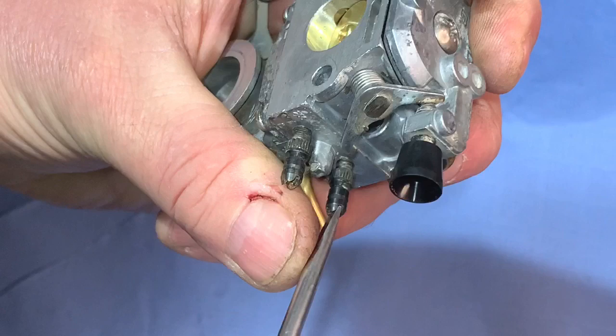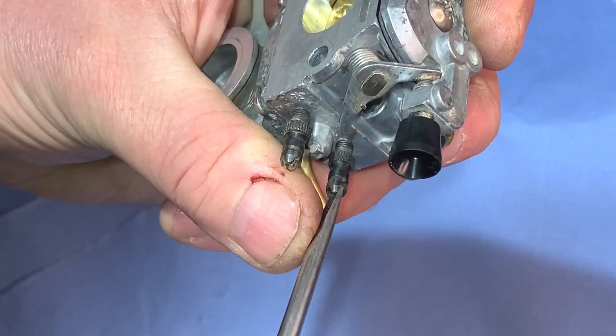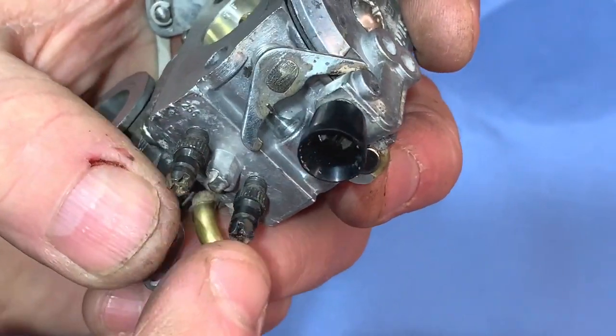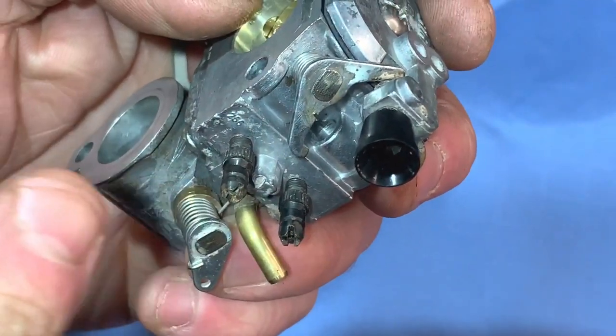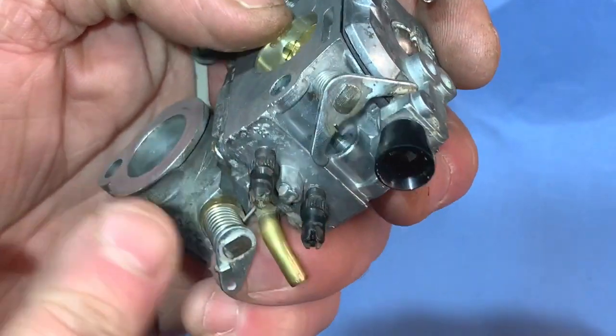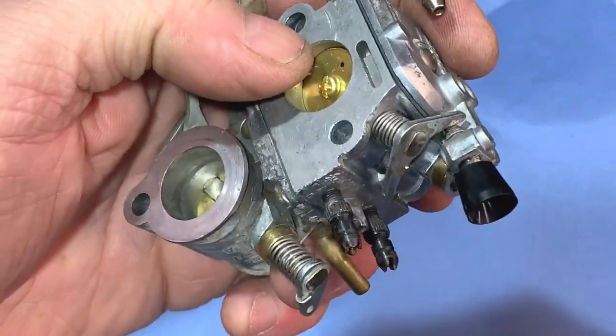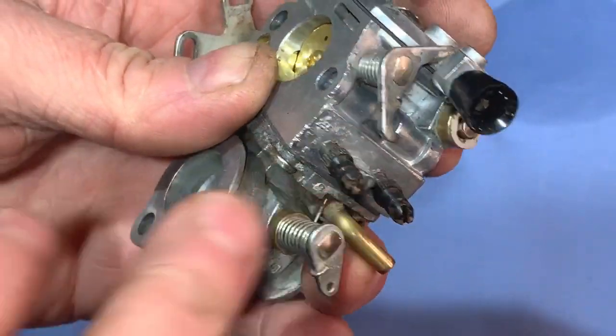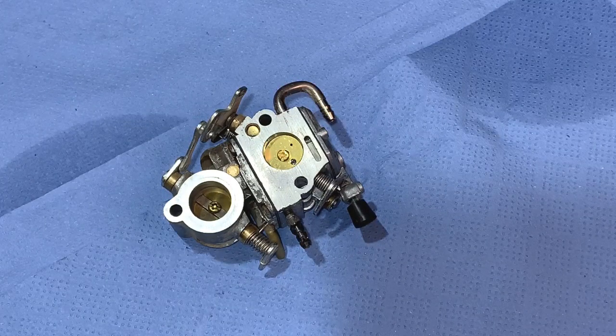The high one goes in — half, one, half, two. That one might be out a little too far; usually both are around one and a half. That one was one turn and this one's two, so I might need to adjust that. But I've got a better range of adjustment now I've taken those little caps off. So that's this carburetor all done — cleaned, new diaphragm and gasket kit fitted, new pin part installed. Hope you enjoyed the video and found it useful. I'll be along with another video soon — bye for now.